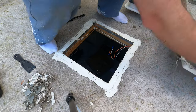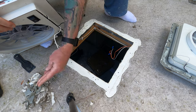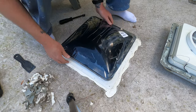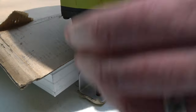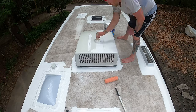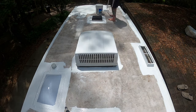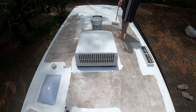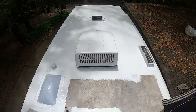Backing up a little bit — before we applied the Henry's Tropical, we made sure that we did all the roof maintenance that we could anticipate over the next couple of years. That included replacing a fantastic vent fan, doing our solar panel setup, putting some vent covers, and doing all the roof maintenance we thought we were going to need to do. Because once you put Henry's Tropical down, we like to say you're married to Henry — meaning you're going to be using Henry's for any other maintenance you have to do.